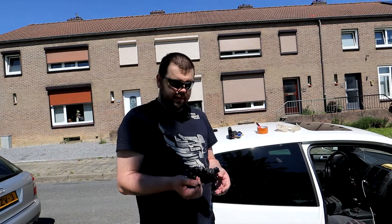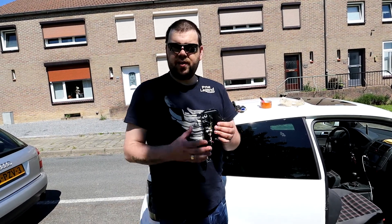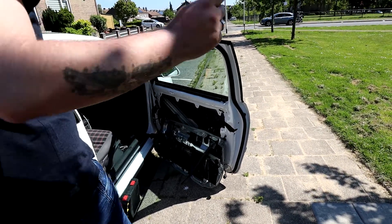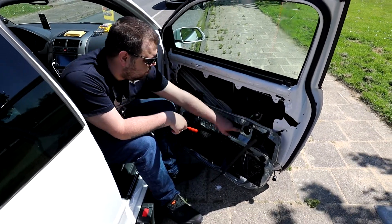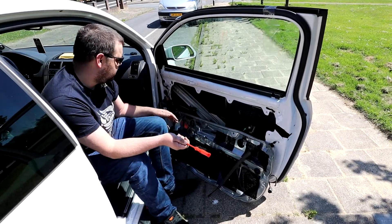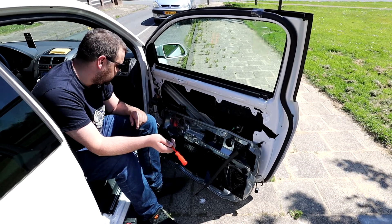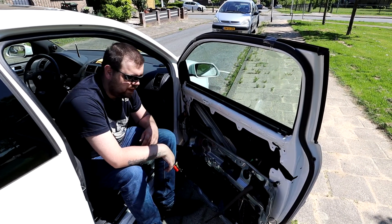Now all we have to do is place it back. The problem is this part right here — that's going to be difficult to return. The rest of it was quite easy. You do the window all the way down until these parts for the window mechanism come up, make them loose, pull the window out, pull it all the way to the top, duct tape it a little bit, not too much, and then just take out those bolts all around. Which is not that difficult. Then you basically lift the entire plate, twist it a little, and just pull it out.